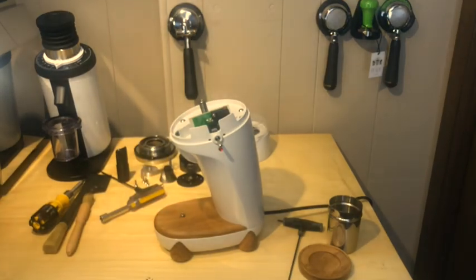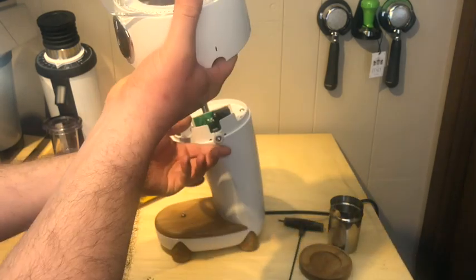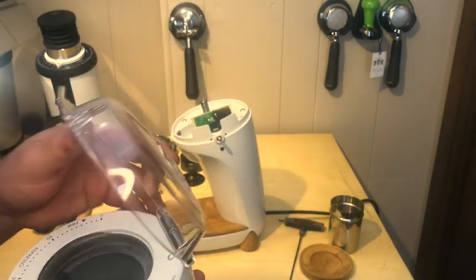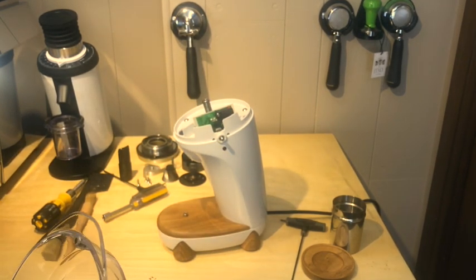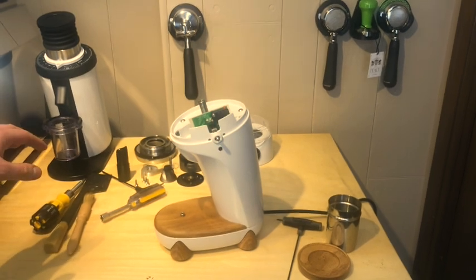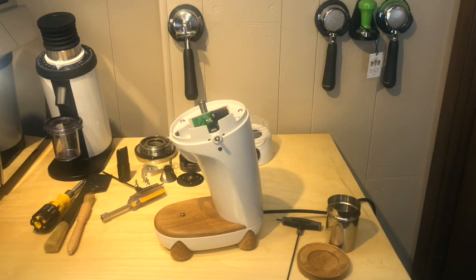Make sure that's unplugged. There's a button on top — when you open the lid there's this red button. If you were to flip the switch on and open the lid, it's going to stop. It's pushing this limit switch on the inside, and that goes through with this red push button. So there's the electronics — not much to it. The Turn had a relay in it, really just to be a timer, so after 45 seconds it turns itself off. If you accidentally flip this on, it keeps running, and you don't want that happening all day.